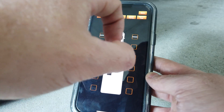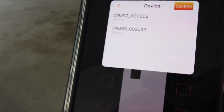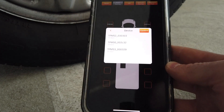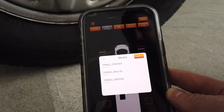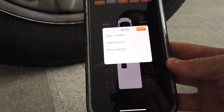If you also want to do your caravan sensors, just go back to Edit, click Auto Pairing, and choose whichever caravan sensor position you want to do. In this case I'm going to grab a brand new sensor out of the box that hasn't been screwed onto anything yet — this sensor at 44 psi, just out of the box. I'm going to screw this onto this valve here, which will probably add an extra one into the screen we haven't seen before.